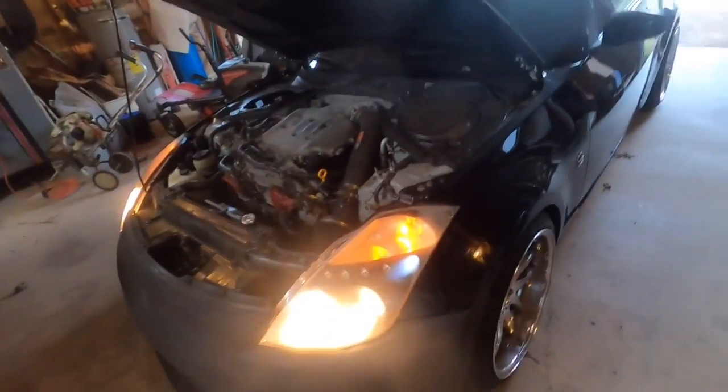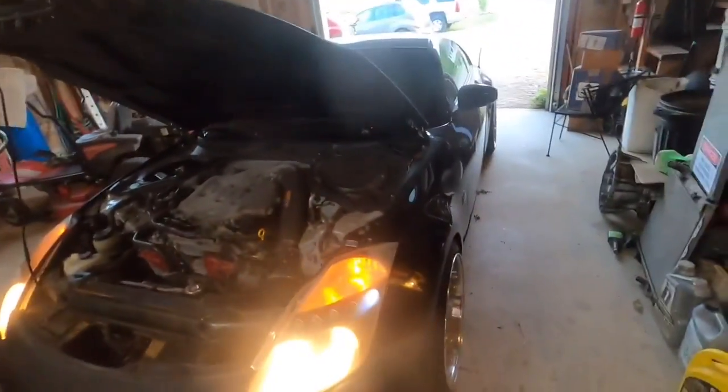So this one is working. The light bulbs, at least, are working, which I guess is good. But then you come on this side, and now just the high beam works. That low beam still doesn't work, and nothing else works in there. I have a funny feeling these idiots put these headlights in. They had to rewire it, because you do when you put in aftermarket headlights. And they had no idea what they were doing when rewiring it. And so they wired it poorly. And that could be a cause of the issue. But once again, I don't know.